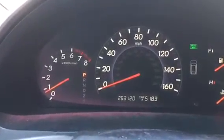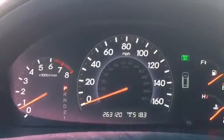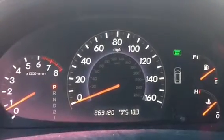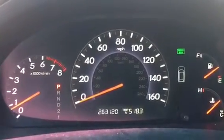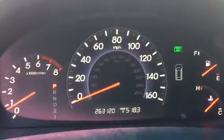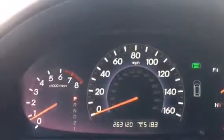The car is sitting here running — it's almost a week later and I've put almost 400 miles on it. The check engine light has come back on twice, but I did not clear it. Notice right here — it's gone. It has gone off by itself and came back on twice, but it has stayed off more than it has come back on. I would say that's mostly due to the modification. Before I did this with the non-foulers, it stayed on all the time — it is now off.